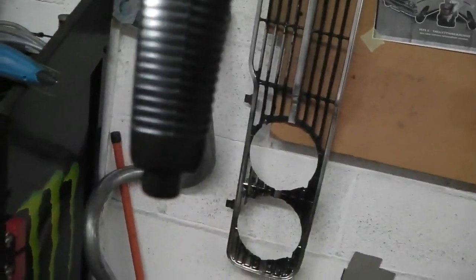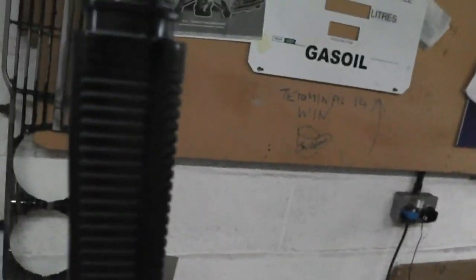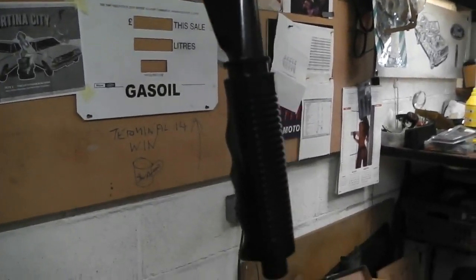So a plastic primer on the handle to give it a key, and then a plastic bumper paint, rubberised paint on the handbrake release handle, and then we've blown grease down into the operating rod so that button's nice and smooth as well. So just as I say, keeping the detailing on, handbrake done, that's part of the centre console, you see.